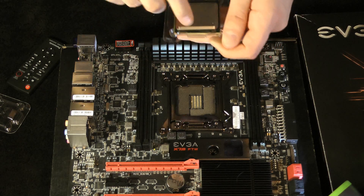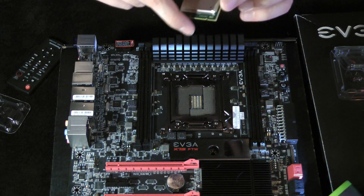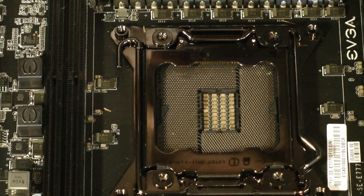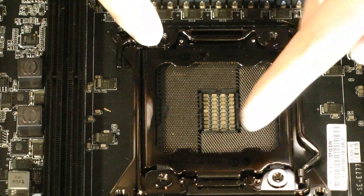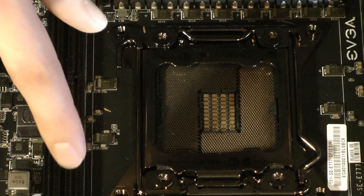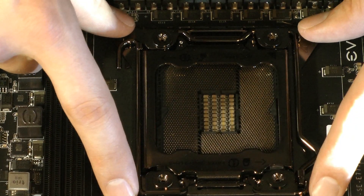So let's open it up and install it. You can see it has two notches here as well as a dot here. I assume the dot is going to line up on the other side — there's an arrow, generally, on the socket. One of the biggest reasons why I'm making this video is that this takes a lot more retention on the chip than the previous chipset. Some people have been asking or screwing up and just damaging their socket by trying to install it. You'll notice it's a lot wider, and the difference between this and the original one is that this has four points that are actually on the board and not through the board, so you actually can screw in your socket stuff right here. If you're mounting a cooling block, you screw it into this bracket — it should help with cracking the PCB a little bit less so you're not breaking it as often.